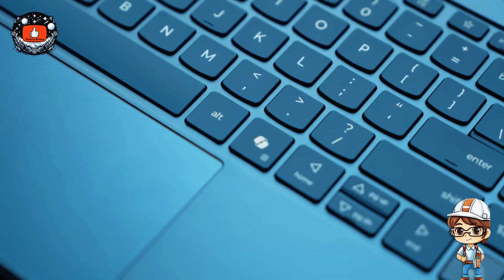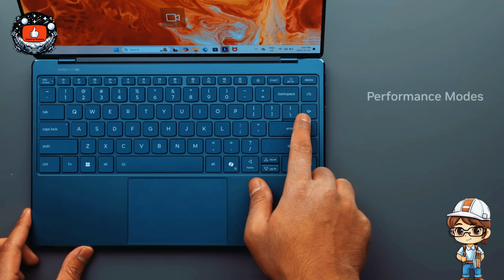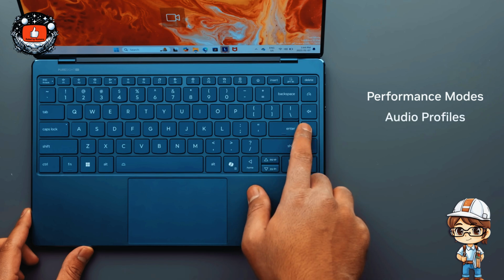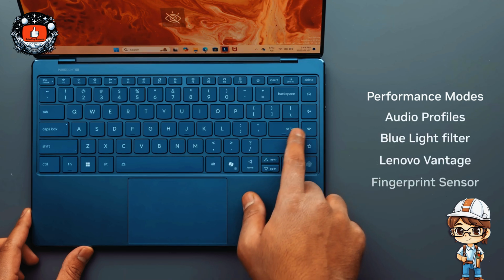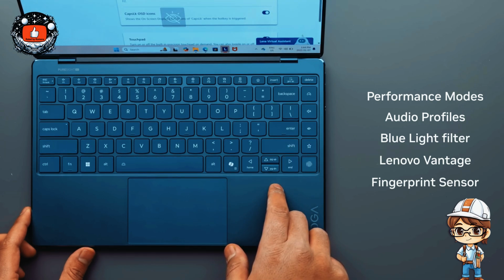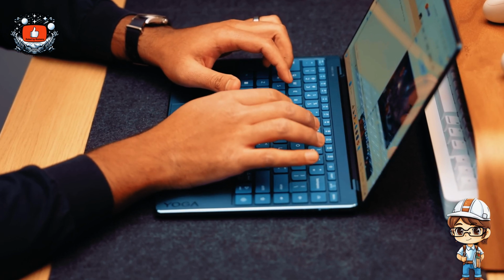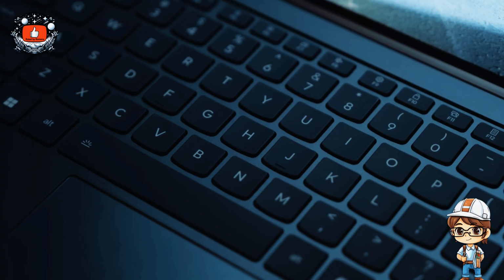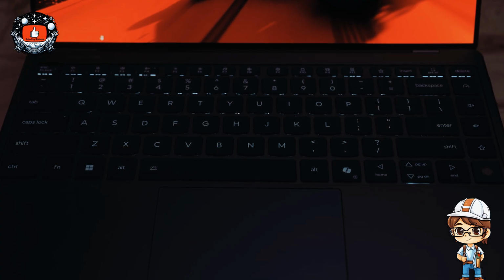I also appreciate the key's soft touch coating and the 2-level white backlighting that makes working in the dark no problem. The main keyboard is laid out as expected and includes a function lock feature, FN plus escape, to prioritize the F1 through F12 keys. The star key beside F12 is a customizable shortcut key, configurable through the Lenovo Vantage app. One downside, however, is the mismatched sizes of the arrow keys, which I find makes me prone to typos.